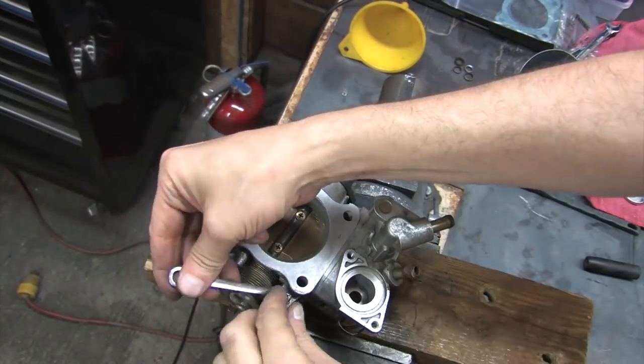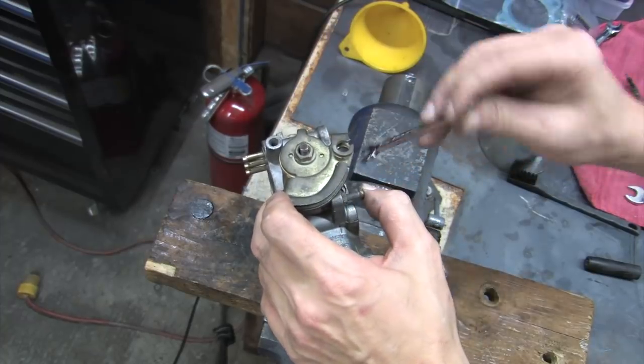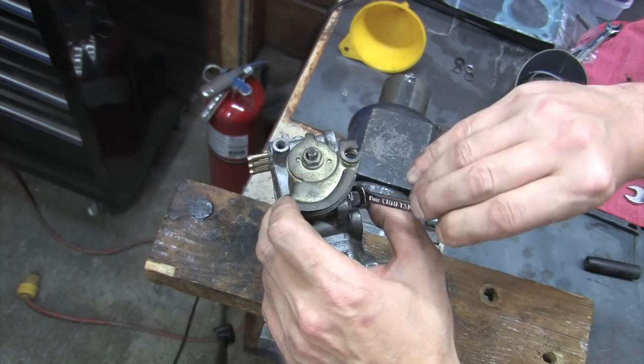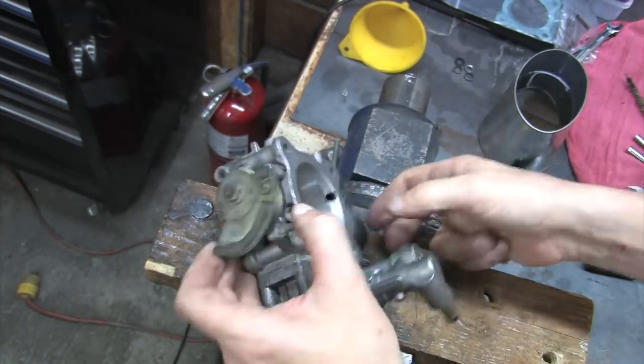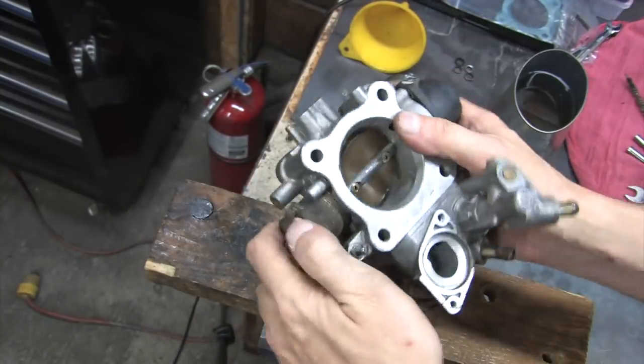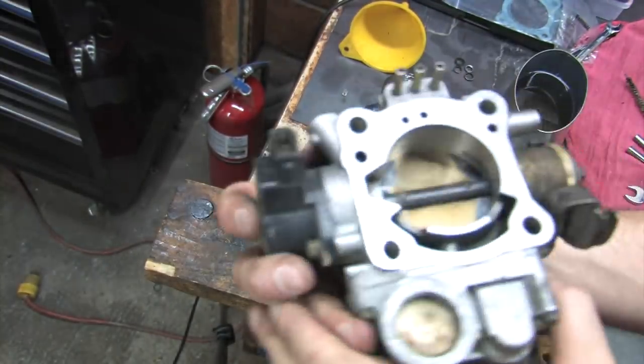Same as before, make sure the throttle plate doesn't stick or drag where you set the throttle stopper, and then lock it back down. I will set my bypass idle air mass with the BIS screw later to get my ISC to operate in range. My ISC motor will do all the rest to keep my idle straight, and I will not be compensating for a leaky throttle plate. This helps improve throttle response.